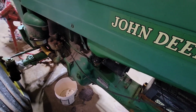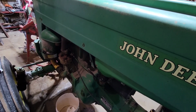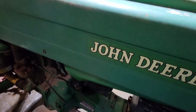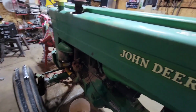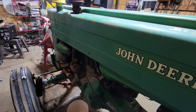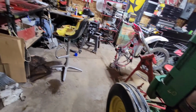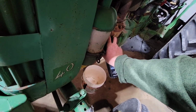Switch is on. I feel like I'm smelling gas. Let's turn the choke off, I guess. Make sure that's all open like it should be, and it is. Let's give a little bit of a boost. See if it wants to fire. If I'm missing spark again. This thing has an intermittent spark issue that likes to come up, I've learned.